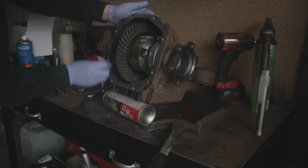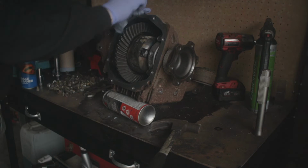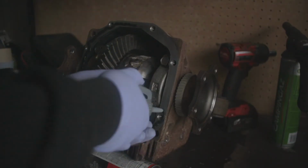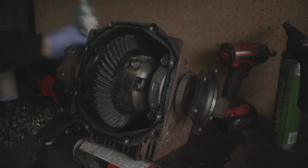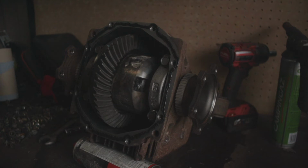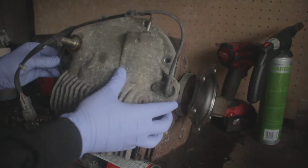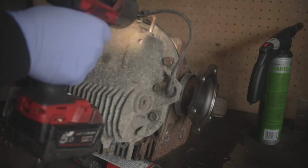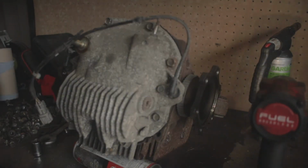Just clean up both surfaces. Going to put the silicone on there, let it become a little bit tacky before we put the cover back on. Nice. Better piping skills than British Bake Off. Just let it dry that little bit and then we're going to put the cover back on. There's no pins on there, so we've got to try and do it nicely straight away. And there you have it.